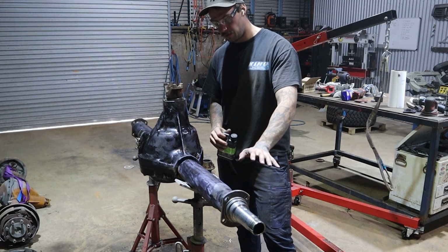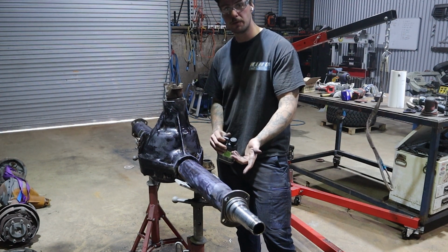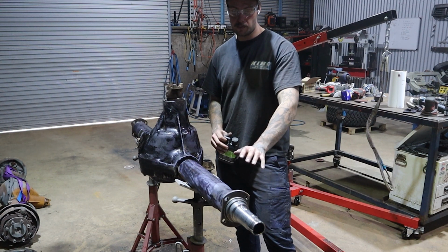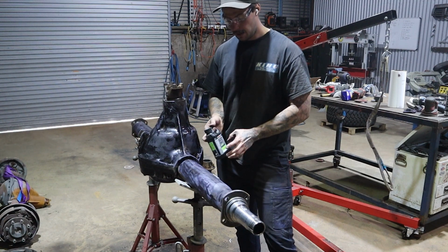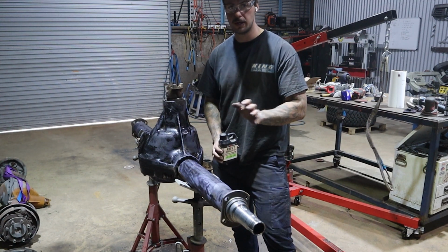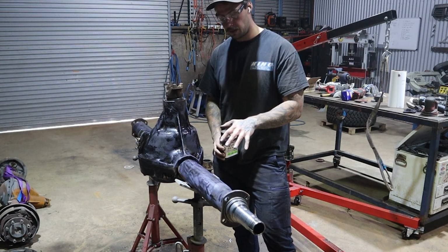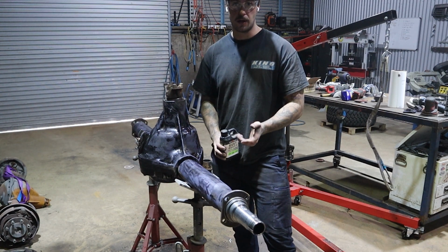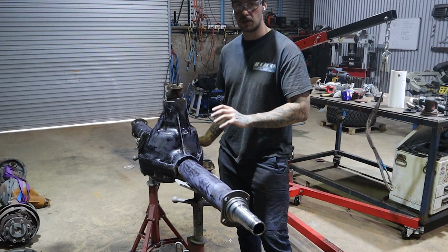So I've just gone through and obviously prepped it down, sandpaper, all that kind of stuff, 40 grit. Got it nice down to the point where most of the pitted holes were all fetched out of the rust and that. But now I've gone through and put a converter on, which is basically going to go through this now, which is 30 years of rust, and start eating right into it. And then we'll let that all do its kind of thing. We'll come back, hit it with a bit of acetone, and then start stripping this down and cleaning it. And that'll give us a really nice base and try and clean this up.